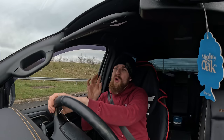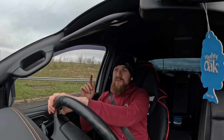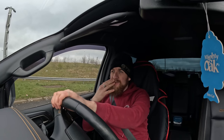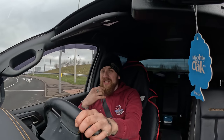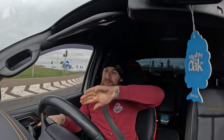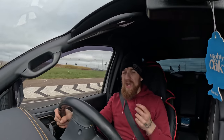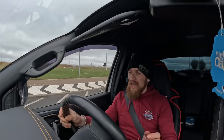Basically last night, the airline blew on the main tank feed. What had happened is one of the tank brackets had rotted and broken — it was on the top side so I'd never seen it during inspection, but it's something we'll have to look out for in the future. Anyway, that blew and the tank slid forward and the exhaust gases were that hot, they blew the airline — it was just a crash of everything.